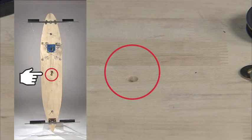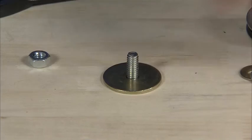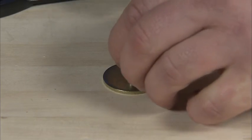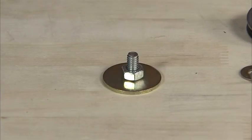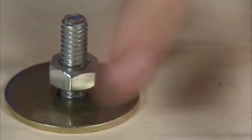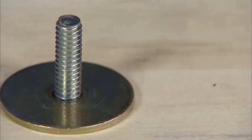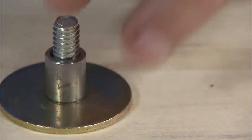Insert a quarter inch by two and a quarter inch elevator bolt through the floorboard bottom at the awning pulley hole location and place a fender washer on the bolt on top of the floorboard. Install a quarter inch nut and tighten it to draw the elevator bolt flush with the bottom of the floorboard. Then remove the nut, add a spacer, and put the awning pulley on the spacer.